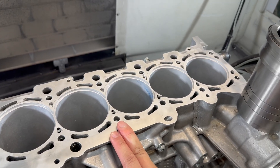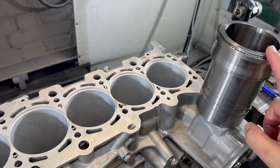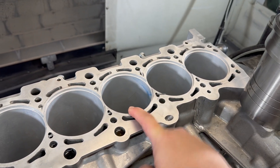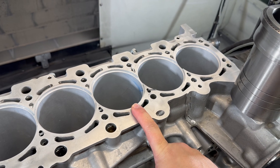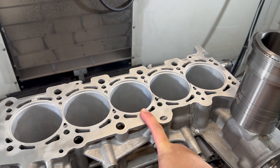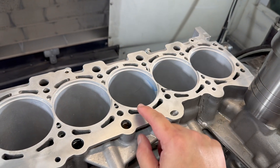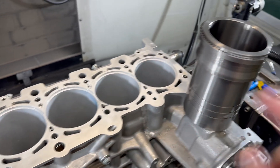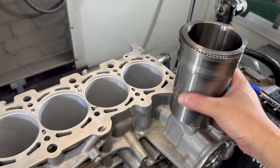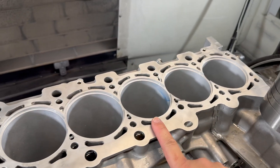There's not a strength problem — it's the inner wall heating problem on the aluminum side. We know ductile iron at operating temperature is at least three times stronger than aluminum, no matter how good the aluminum is. This is just the nature of the material. The whole point of wet sleeve conversion is not that it will increase the block strength significantly. It's because we want the overheating area to be swapped out from a soft material into a strong material, so any aluminum exposed to heat is far below the deck surface, far below the top deck center.